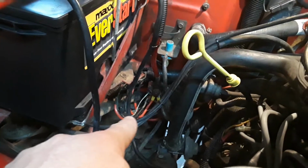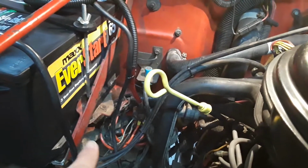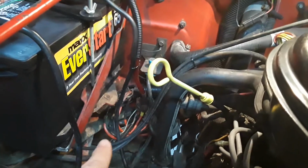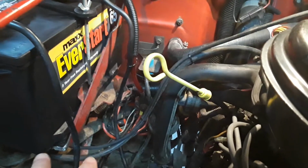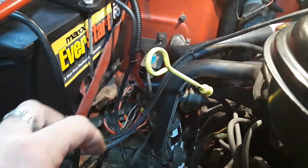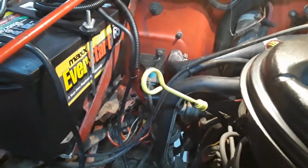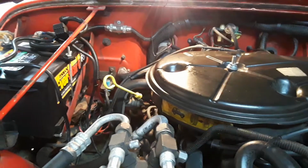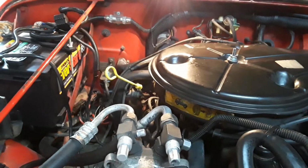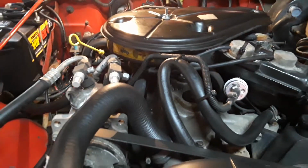That really doesn't matter. If you have that with those little tiny wires down there, and you're capable of getting down there and cutting them off and properly crimping and soldering them, just don't crimp them alone or solder them alone. I highly recommend a physical connection and a soldered connection, and then heat shrink it, so that way you don't have any problems in the future. Your vehicle will run so much better. It will run way better. It just runs excellent now.